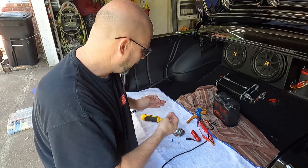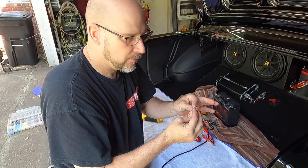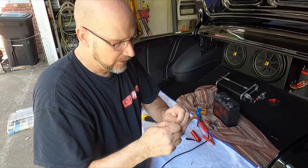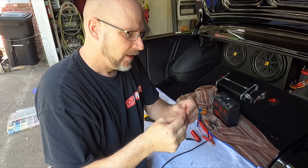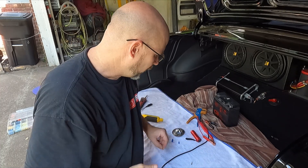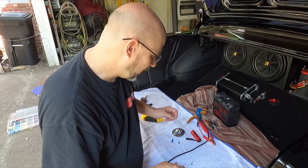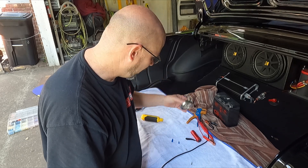The two that I actually used to kind of hardwire this to figure it out, I barely crimped them, so I can go in with a pick and open that back up and still use them. What I usually do is peel off that cheap plastic insulator, and then I'll use my good American Auto Wire crimpers, crimp it on there, and then heat shrink the end of it. That is how I'll connect this.